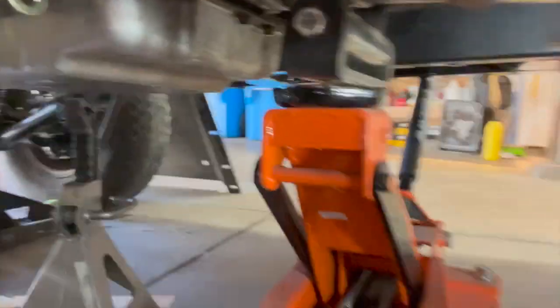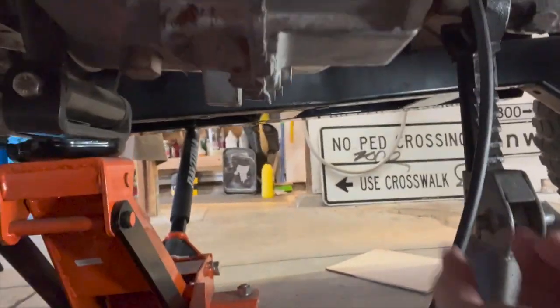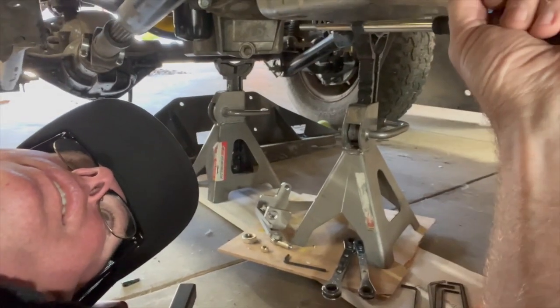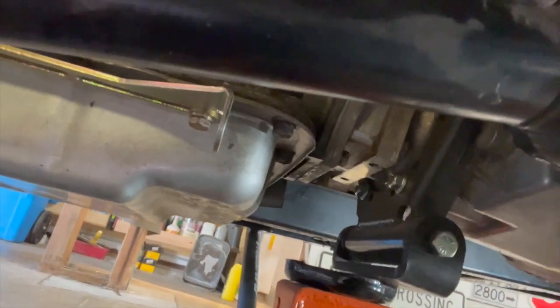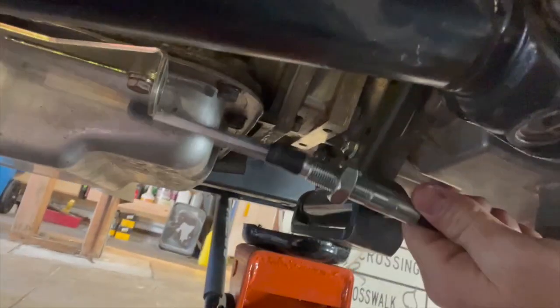I have this rod right here, okay? Now this rod is what allows you to change the gears in the transmission. I appear to have an issue. My issue is this bracket right here is too short, or this cable is too short, one of the 2. So I think I'm gonna try and move this bracket back this way so that this can connect.